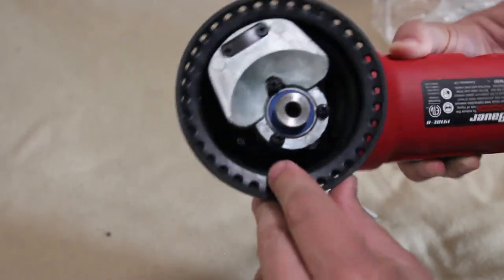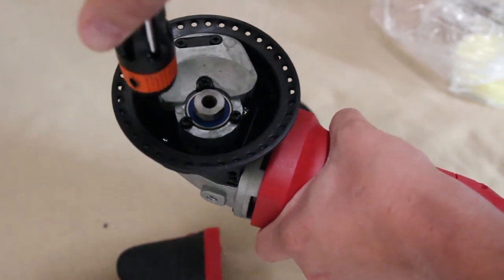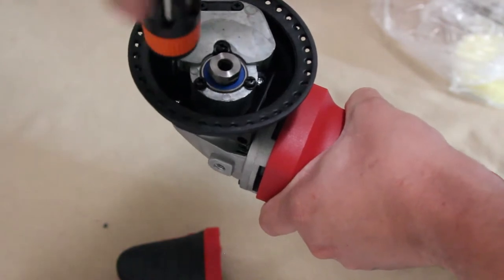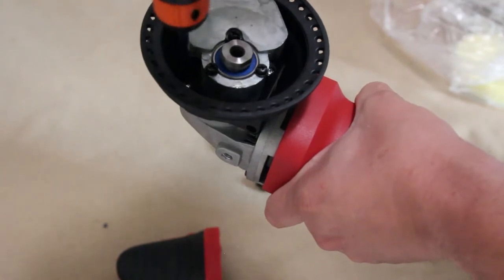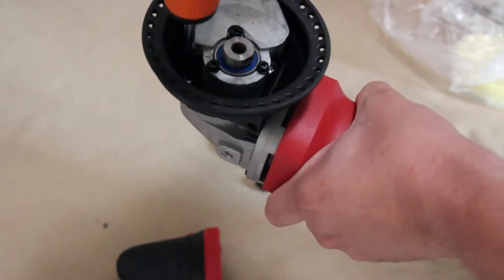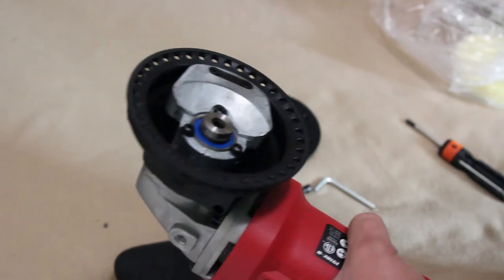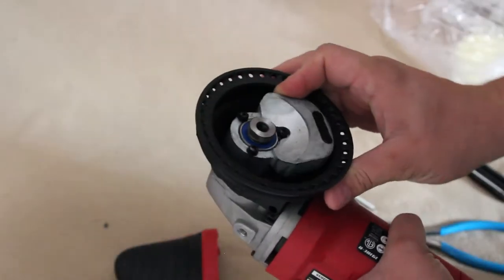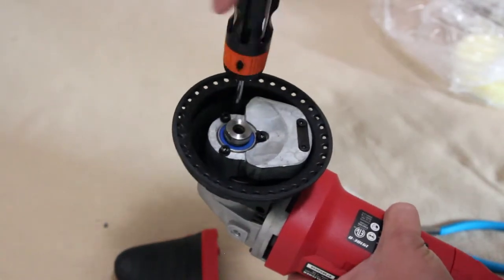You can access the gearbox without that extra process. At each of the four corners of the gearbox is a Phillips head screw. You will need to remove them one at a time and completely — if they are partially out you can't rotate the counterweight to get to the next screw. Once you've undone each screw fully, I found it easiest to use needle nose pliers to pull the screw out the rest of the way. The key is a good screwdriver and needle nose pliers to make the job easy.